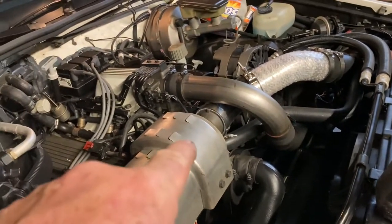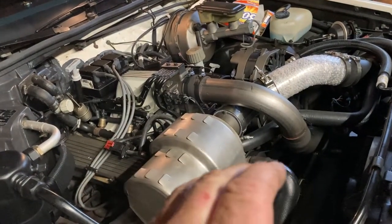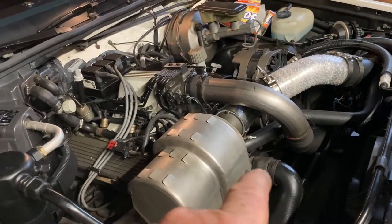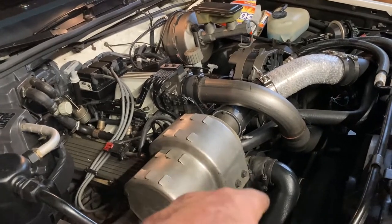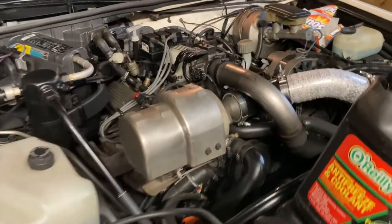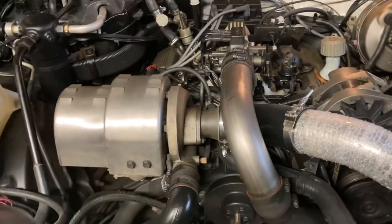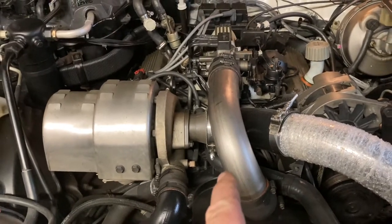And I got a little hole. What I do is I spot a hole in the T-stat. A tiny little hole. What sense does it make, in other words, to fill this with coolant if you were to drop it, say in a water pump example, put a new T-stat in while you're in there. I got 160 degree in this one. And not have a bleed hole.